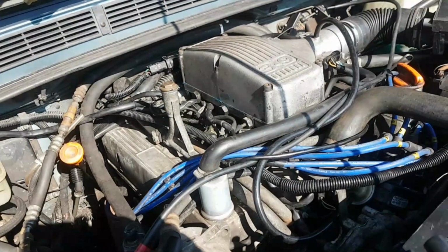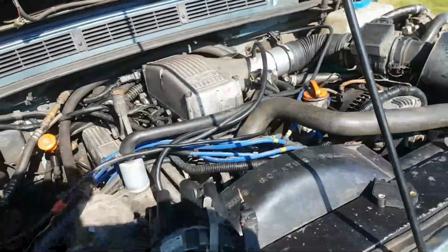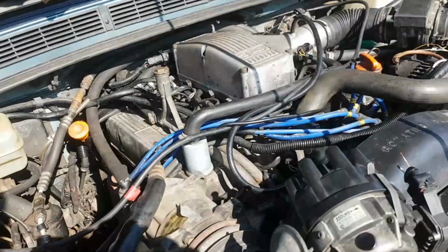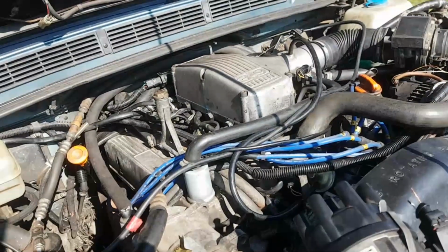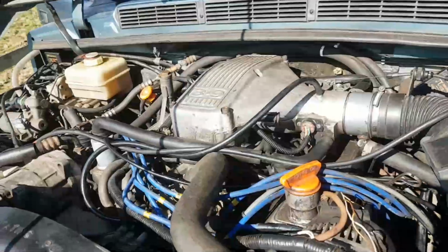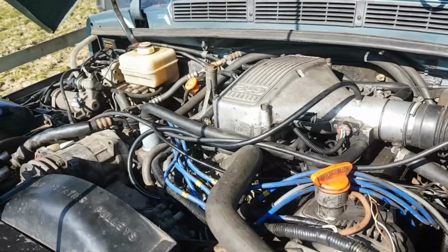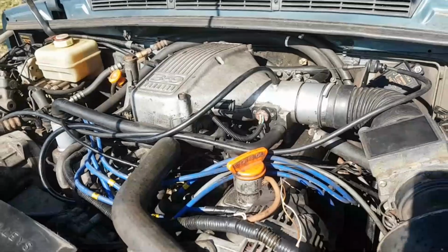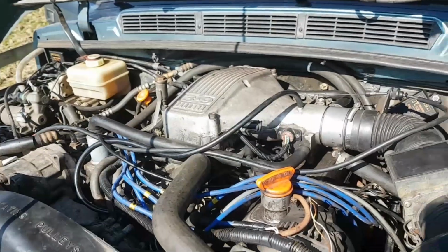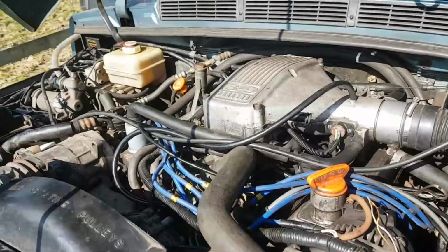I've got one of the original diagnostic kits, the diagnostic plug-in where you just use the 2 digits to establish the engine code and so forth. But then after a bit of research, I found Rover Gauge, all fantastic, a bit of freeware software. Buy a cable, plug it into the diagnostic port, the loop-back diagnostic port. I will do a review on this, and amongst other things, it does tell you what the RPM of the engine is. Great, let's plug it in, put the laptop in the car, let's crank the engine over, and sure enough, the ECU is detecting that the engine's cranking over 150 something RPM. So, ignition's working. Bloody hell, what can it be now?